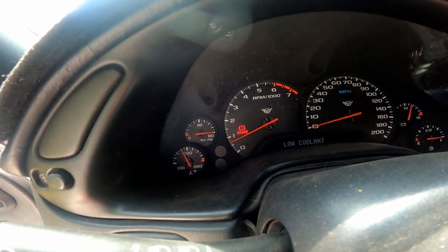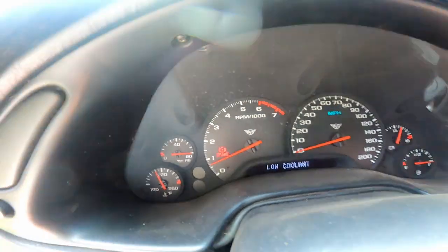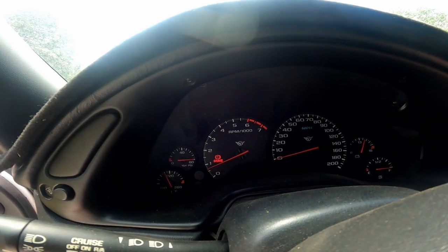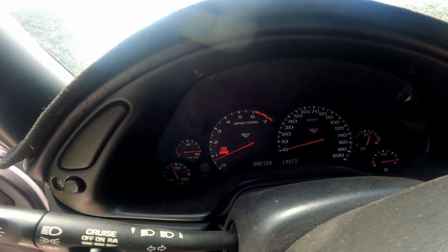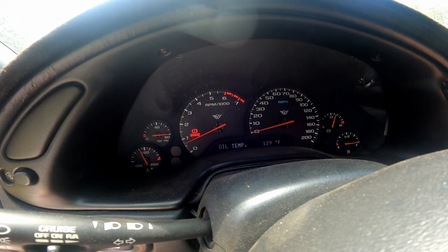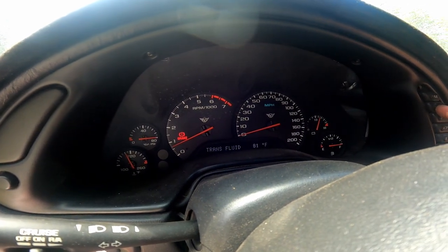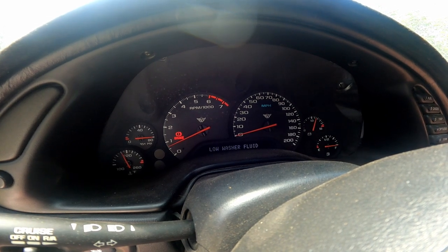Temperature wise, running good. Don't mind the oil one — it doesn't work, it has never worked, someday it will. Oil pressure doesn't read out, oil temperature 129, cooling temp 194, transmission 81. So yeah, there we go — sounds pretty healthy, ready to drive again.